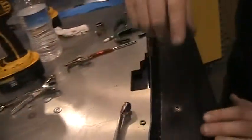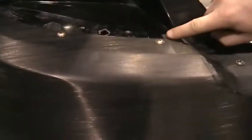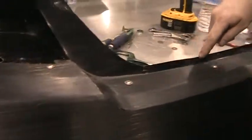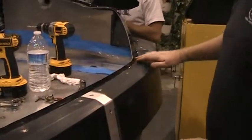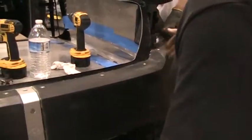The first thing you want to do is lay out a strip of foam tape, which is basically in line with the trunk wall. It'll come up this way, then you keep it along the seam, come down into the center section where the recess is for the center strap, up along the other side, and then the same thing as a strip that goes the length of the car right here.